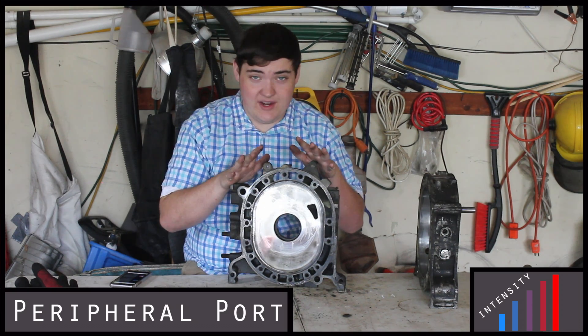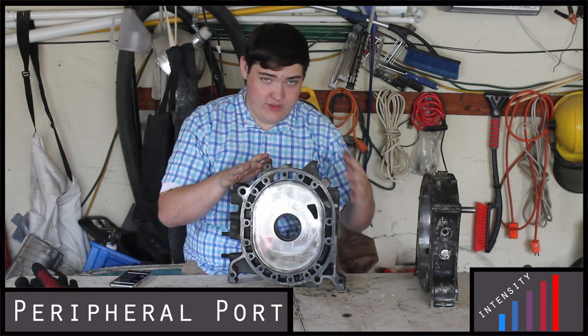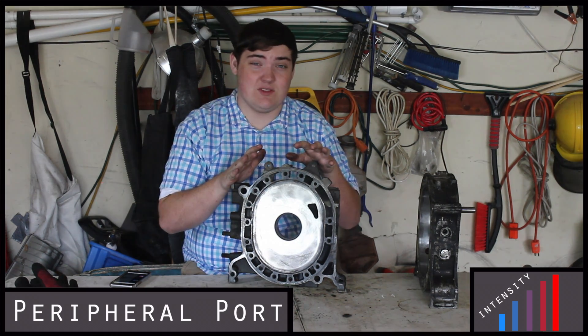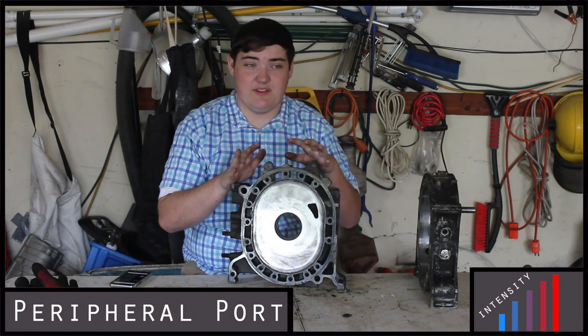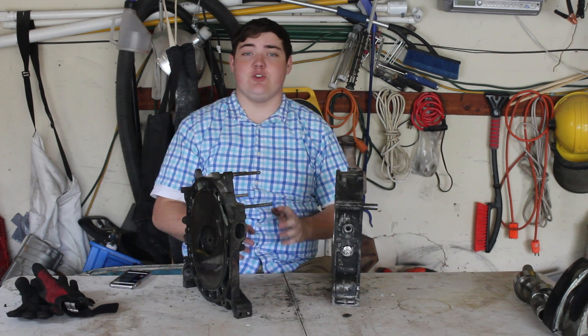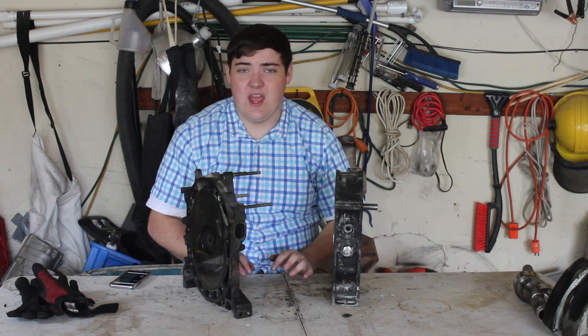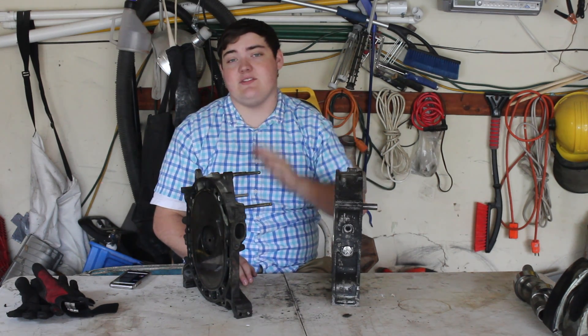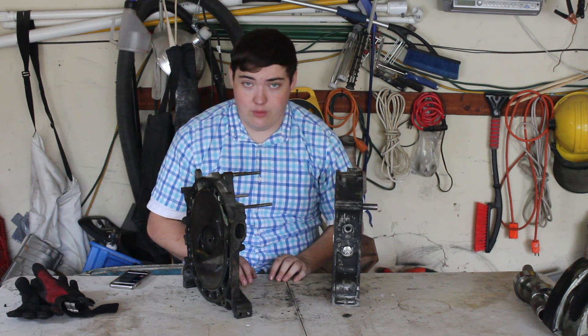So if you plan on really racing your rotary engine, you can go with that kind of port. But if you just want to make monster power, I would recommend a slightly smaller port — if not a bridge port, even a street port. And with all this porting, obviously as the sizes get larger, you're going to want to cut your exhaust port larger as well to fit the requirements of all that power going through your engine. I hope you guys enjoyed this video — don't forget to rate, comment, and subscribe if you really liked it. If you have any questions about porting an engine, please leave it down in the comment section below. Take care, guys.